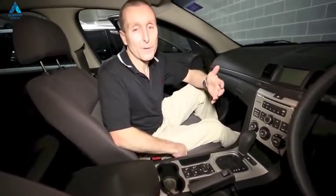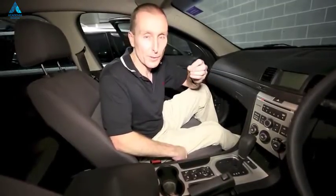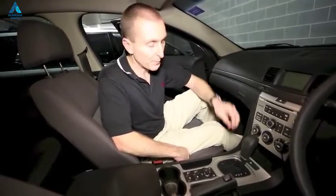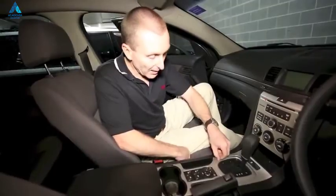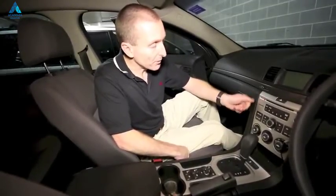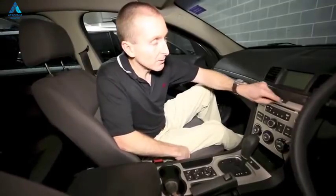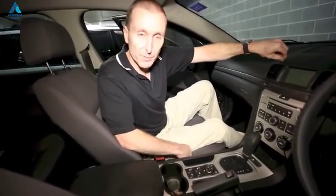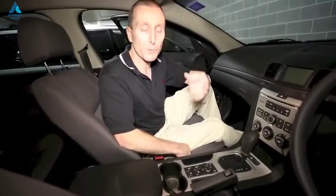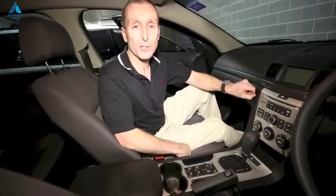Okay, now if you're also perhaps wrapping some internal parts of the vehicle with the wrap film, really the same rules apply. The film should only be applied to a smooth, rigid plastic surface. So with some of these interior parts, yes, some of them are smooth, rigid plastic, others are soft and flexible. We certainly shouldn't be applying any film to this. Hard and rigid plastics, yes, are okay. Also be aware of some of these highly textured surfaces. Again, the adhesive will struggle to make good contact with that surface and we won't get great adhesion. But again, these areas here, smooth, rigid plastic, will be fine. Up here, soft, flexible plastic, no good. That, smooth and rigid, is okay. So again, those same general rules apply. The film will adhere best to those smooth, rigid surfaces, and we shouldn't be applying it to any surface that's soft and flexible, or that really has a significant surface texture to it.